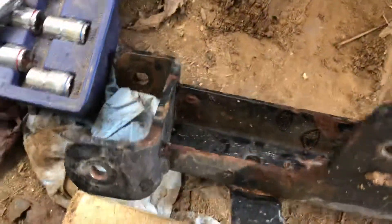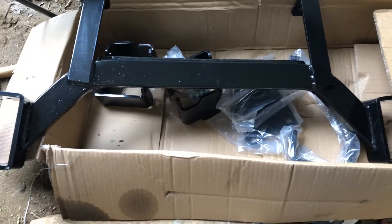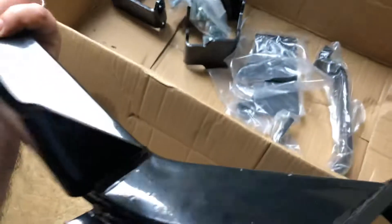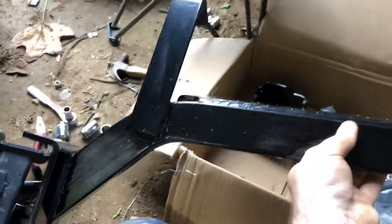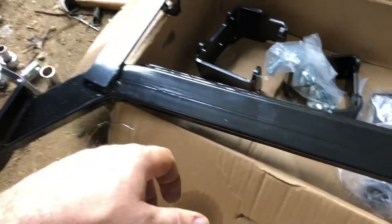See, the stock one is just a channel — just open-backed. I know we're talking golf carts and don't have to be super heavy-duty, but I wanted to show you this 6-inch drop axle I got off Amazon for $122. It is enclosed, really heavy-built, and it already has the drop made into the axle, which I think will be a whole lot stronger than a spindle drop lift.